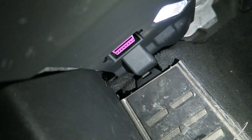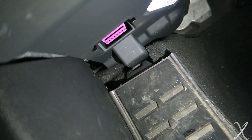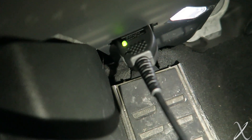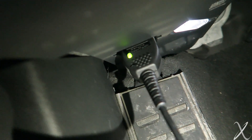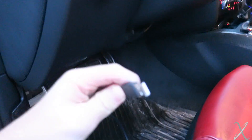First things first, I'm going to find the OBD2 port, plug it in, hook it up to the computer. There we have the OBD2 port — got my phone flashlight going, you can see the pink connector right there. I hook up the cable, hooked in — there's a little light indicator that I assume means it's got a proper connection. Let me grab my laptop; it's just USB straight into the other side.